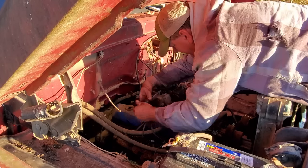Alrighty, I have taken entirely too much time today working on that carburetor and the fuel pump and all that. I ain't got a whole lot of daylight left. But I think what I'm gonna do first is get my little air tank out and blow through this fuel line here. I'm not gonna take it loose from the other end. We'll just blow it into the tank. I'll take the gas cap off. I need to do that first because my little air tank has a leak and ain't gonna last very long. All right, let's blow this line out real quick. Y'all listen, see if we get air through the gas tank. Oh yeah. Yes, sir, I believe we're good there.